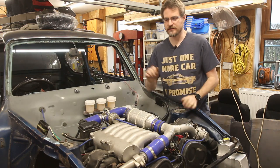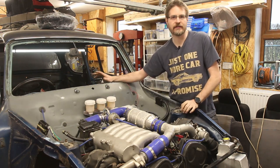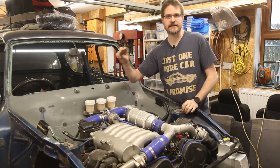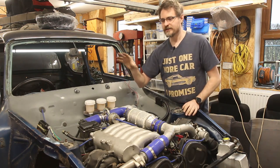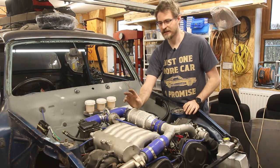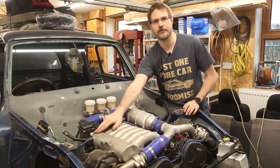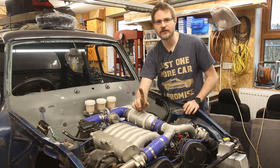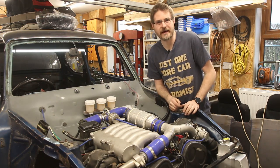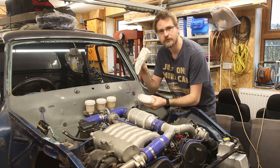Okay, I think that'll do for a bit more wiring for the moment. I'm going to turn my attention again to the engine bay. Over here on the inlet manifold is an outlet and a bit of pipe that did go off to the back of the car - that was my vacuum feed for the brake servos that were in the boot. I've no longer got those because I've replaced the pedal box and master cylinders with new ones, which means I shouldn't need them. So that means I've got this outlet on the side of the manifold that is a potential place to have an air leak. What I'm going to do is pull off the inlet manifold and then weld up that hole. While I'm doing it, one of my very good friends has sent me through a set of 1000cc fuel injectors and all the various adapters that I need to make them fit.